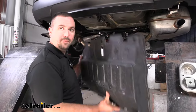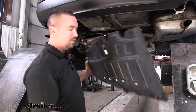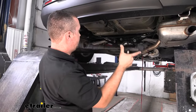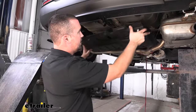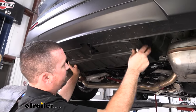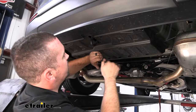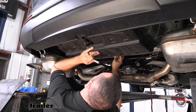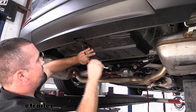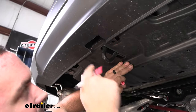Now we're also going to be cutting our underbody panel. You can choose to not put it back on — that's completely up to you — but it's not a whole lot of trimming required. To make sure it's nice and even with what we previously cut on the fascia, I'm going to mock this up and slide it in place as it would go back. The cut is going to be a little bit wider to account for where the plates are welded on. I'll check all the mounting points, center it up, and then mark out exactly where we cut from the other ones.